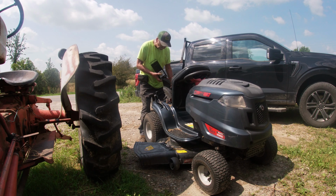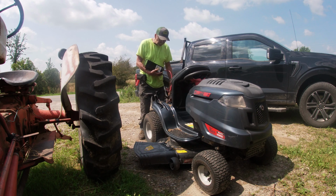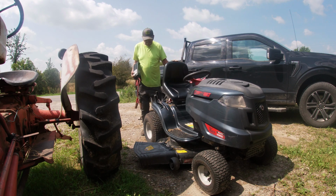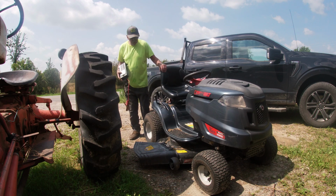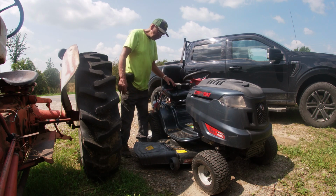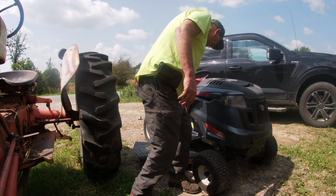And that's very important. But we want to eliminate the battery first, alright? And this battery is good. It tests good. And you can also test these under load to see if it comes back quick or whether it's slow at coming back. So once we've tested the battery and the battery's good, the next thing is getting underneath the hood.